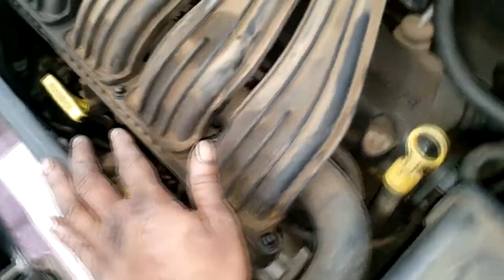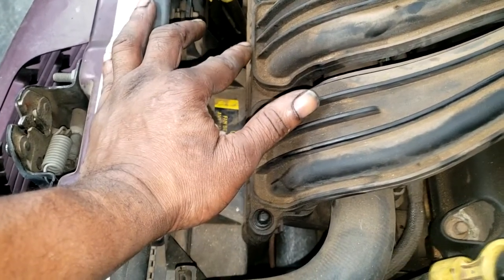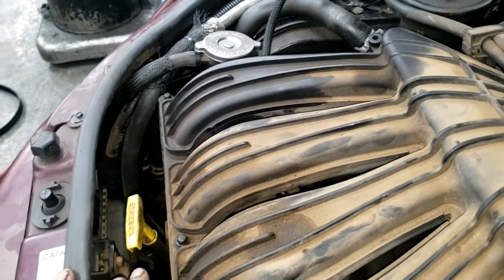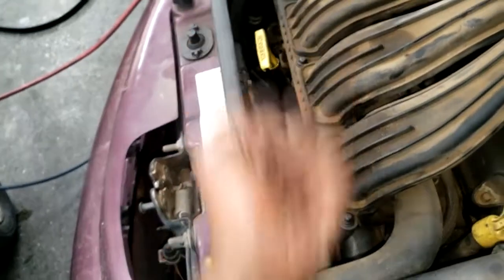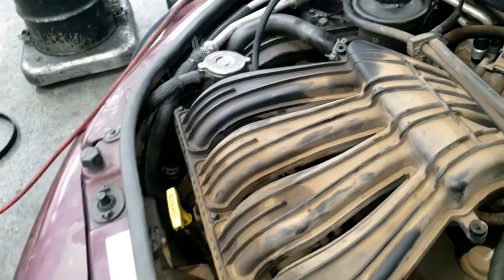I got it filled up with freon and guess what's not happening — the fan is not coming on. AC triggers fan operation on this particular car; the cooling temp sensor and AC trigger fan operation. I have the AC on, it's cold inside. When the high side pressure reaches a certain threshold the fan is supposed to come on. Do y'all feel that jerking? That's because the fan is being commanded to come on but it's not — it's pulling the whole electrical system down.